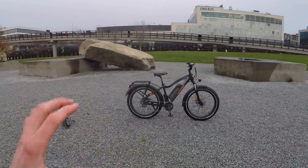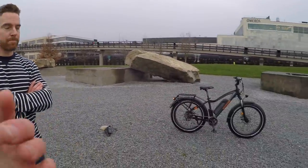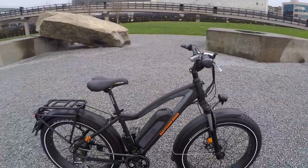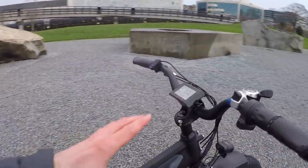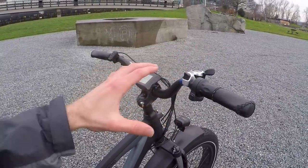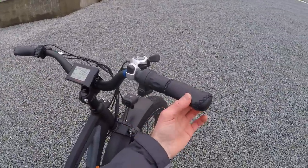If you get this bike, it'll come in a really big box but be fairly easy to set up. It's nice if you can go check out one of the service centers. It only comes in one frame size, but the top tube is sloped down quite a bit. It comes with a 350 millimeter seat post so it's fairly adjustable, set up with a shorter stem and mid-rise bars that can be tilted forward or back to adjust reach. It's a very upright, comfortable position with stitched faux leather ergonomic grips and a Velo plush saddle with a little handle on it.